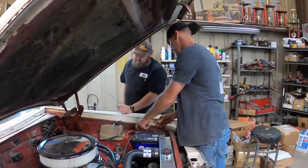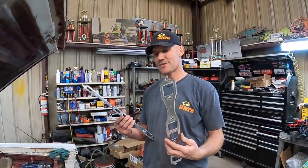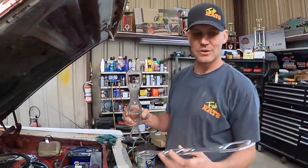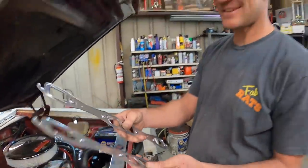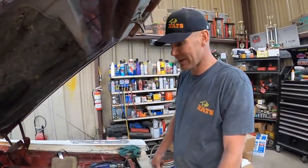This header, guys, is history. But I got these — some silver goods. For all you guys out there that run headers, you know about these. For guys that don't, these are called Luma-Sils. They're double — well, triple — so they press together. These are the good header gaskets. We'll put those on here so we don't have to deal with this problem again.